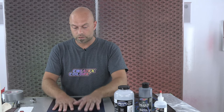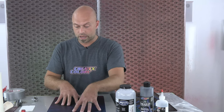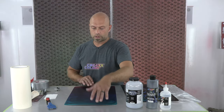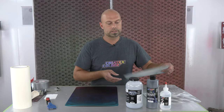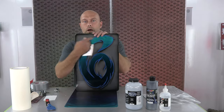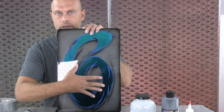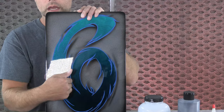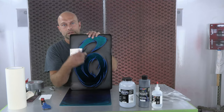That was about two hours for the candy to dry, but this has been overnight so it's totally solid and ready to work on. I'm actually not going to top coat this with anything — the candy mixed with the 4050 has extremely good fingerprint resistance. So I'm going to tape right on top of this. The reasoning for spraying the entire panel candy first is I'm going to work positive-negative. Rather than outlining the number and spraying candy on the inside over a background, it's way easier to cover the entire panel with candy, then do a positive graphic — tape off the number six and spray the outside. I used silver sealer and a little bit of our brand new Wicked Charcoal 359 Charcoal Metallic to get the fade on the outside.